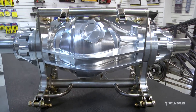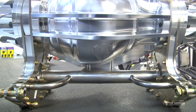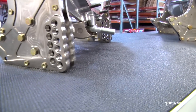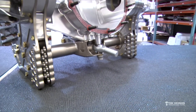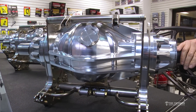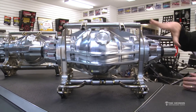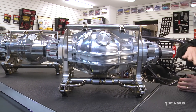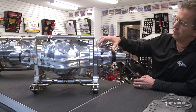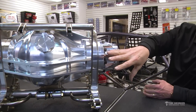This housing here is actually a drop-in for a Bickle chassis car. We have a lot of requests for billet housings that fit in his chassis, so we have the brackets that duplicate the exact hole locations, shock locations, and all the stuff they use — including the center-point wishbone mount on the housing with the doublers. The brackets are exactly like what they use in the car, so you can literally drop this in. One thing we had to do in the redesign was pinch the four-link in a little bit, so this is a 16-inch center-to-center four-link, which is very common on their chassis. Everything will hook up, wheelie bars will hook up, everything is in the right spot. We can also alter the width, and you can see this one is a little bit wider — we made a spacer to get the exact wheel-to-wheel width that we want.